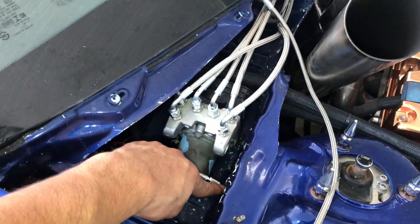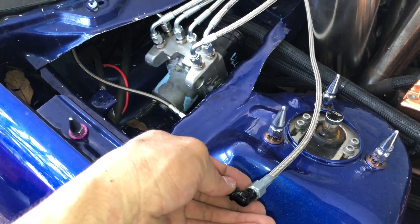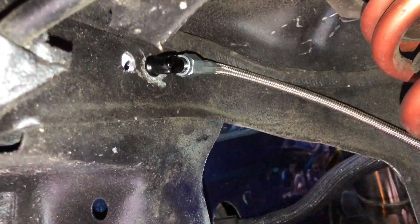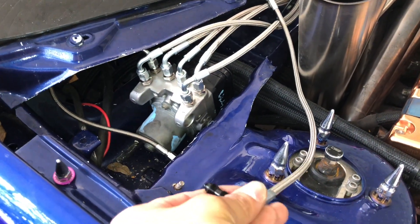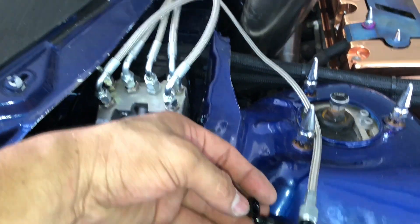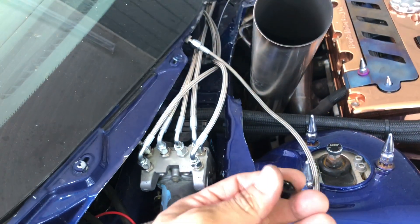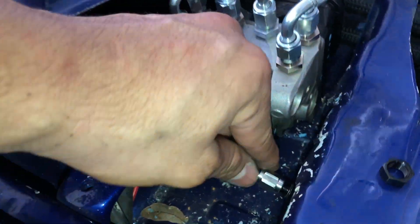The way I did this: I went and made the hole first, and then I inserted the fitting with the line already attached, because if you do it without the line it's really difficult to put the line on the fitting afterward — it sits super tight. My recommendation is go ahead and tighten the line onto the fitting first, then slide the fitting through the hole, and use the little nut to tighten it all the way through with a 13 millimeter socket. Then come with your passenger brake line and tighten it all the way.